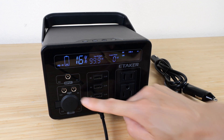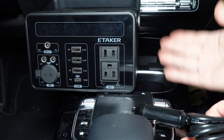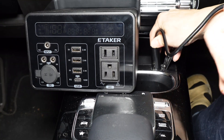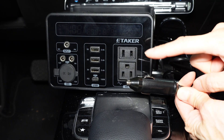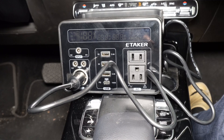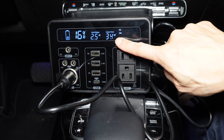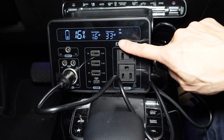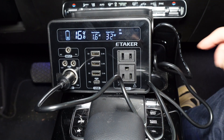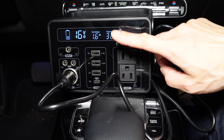Let's give the car charging a try. This cable is super convenient because you never have to open your hood. Just find your car's adapter port, plug this in — be careful with the live voltage end — then plug into the power station, turn the car to accessory mode without starting the engine, and turn on the DC power. The display showed 25 to 35 watts going out into the car, charging the battery. Just wait for the car to collect some energy and then attempt to start it.